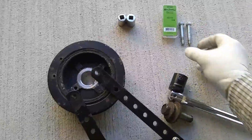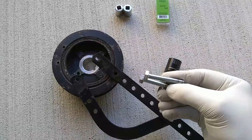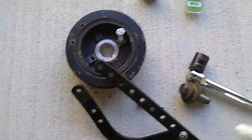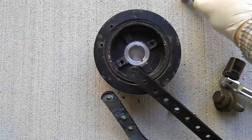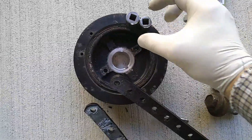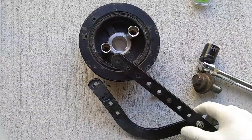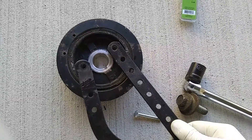What I did was get a couple of metric bolts — these are M8 bolts, 50mm long — and these bolts fit the thread right here. Everything is metric because that's a Toyota. I also put under the bolt a couple of sockets. These are 3/8 sockets of the same height — that's important, the same height. You put the flat surface, the side that has more flat surface, closer to the bottom. Then use these as spacers for this tool. I'm going to screw the bolts in and show you what it looks like.